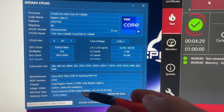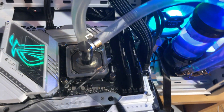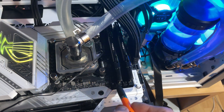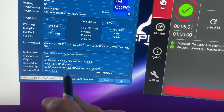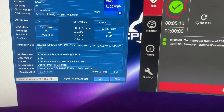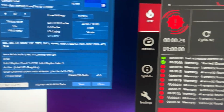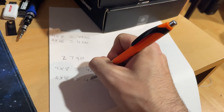On 2x16 we actually got one bin up — we're at 4,266. I think that's more about the motherboard binning itself rather than Z790 specifically. Sometimes the secondary slots have crappy memory traces while the primary ones are fine. That's why extreme overclockers bin motherboards themselves — sometimes you get lemons, sometimes good ones. This is pretty much within margin of error, going up or down one or two bins. I tried 4,300 and it errored out in 15 seconds. So 4,266.